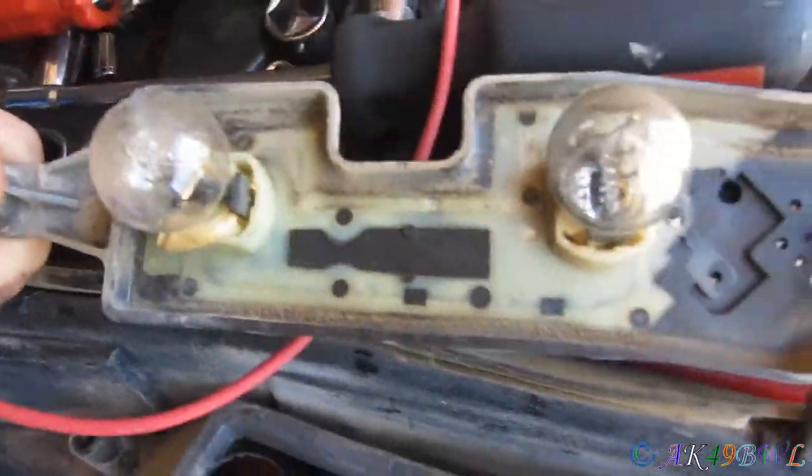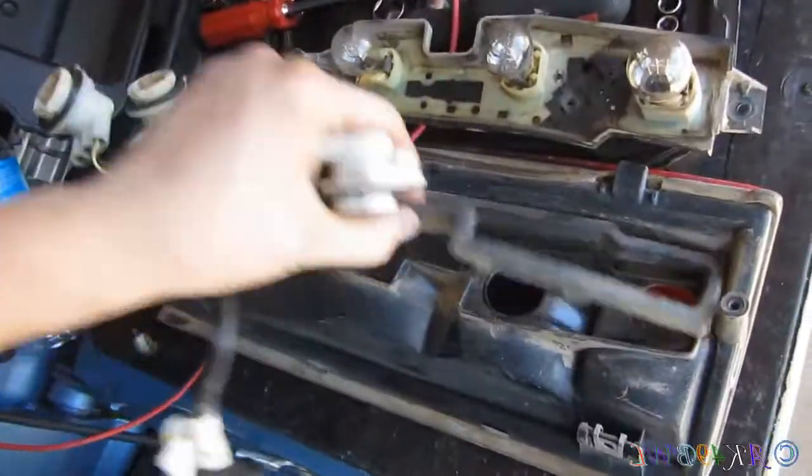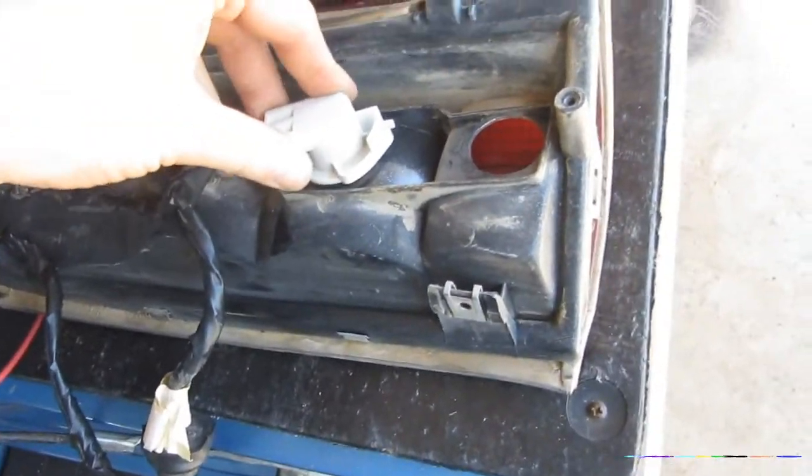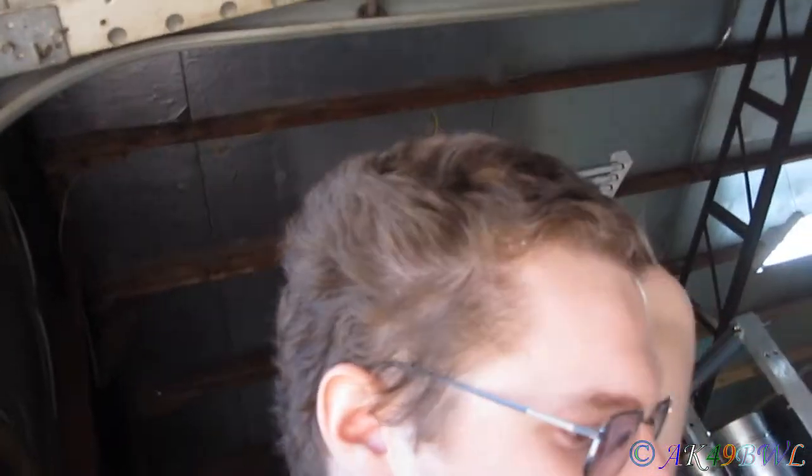Unfortunately with this being a circuit board I can't modify it. And even further unfortunately I can't even use a harness like this one and modify it because the darn holes are too big — so I can't snap it in place, it just falls out. So I'm a little out of luck on that one and it doesn't really make me too happy. Let's see if I can maybe find some tail lights that are different, because I think these are all the same from like 88 to 98 — for SUVs and pickups they use the same tail lights for all of these GMT 400 series trucks.